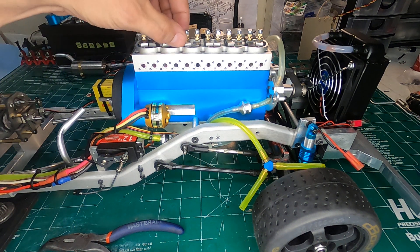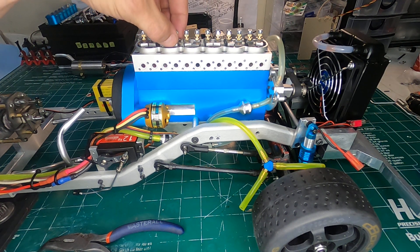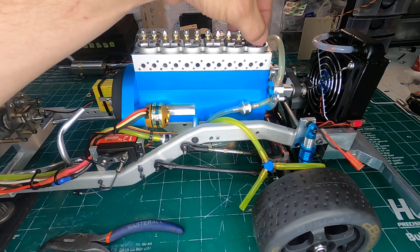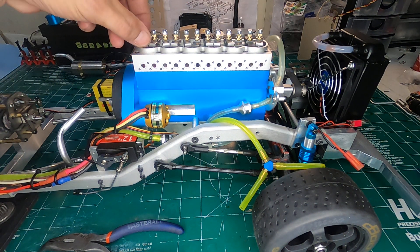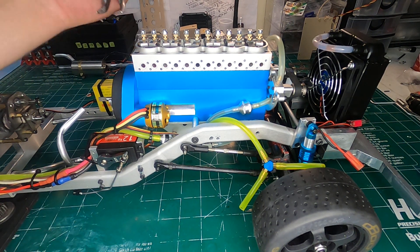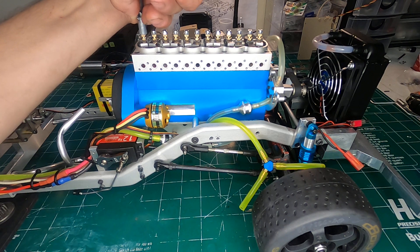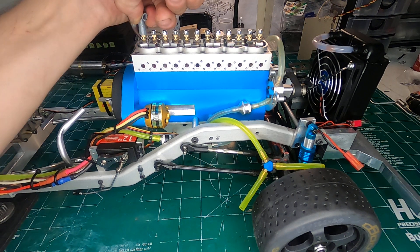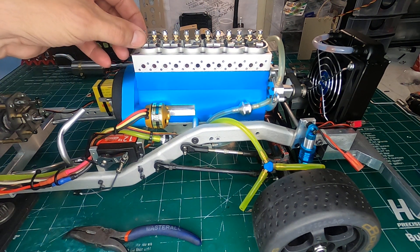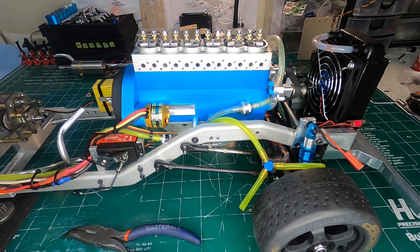All valves move loosely side to side, none of them feel like they're tight at all, which is good. I actually still have a bit of up and down play on all the open ones. This one feels a little bit tight, so I'm going to sacrifice a little bit of stroke to ensure that I have fully closed valves. I'm going to take this back a sixteenth of a turn, then loosen off the slave nut and tighten everything together. Now that does feel better — I have just a tad of up and down here. All my valves are now adjusted.